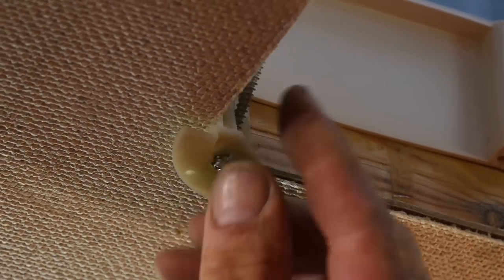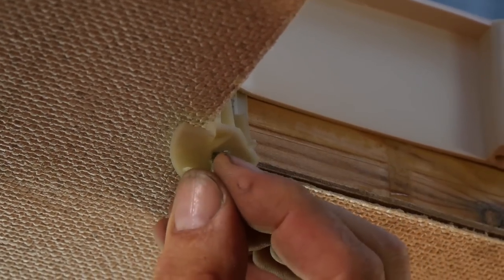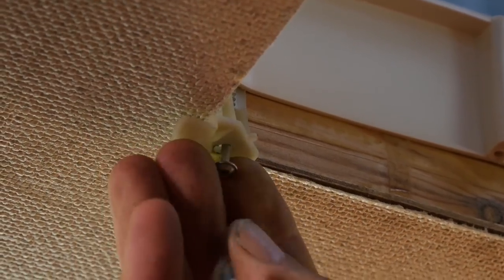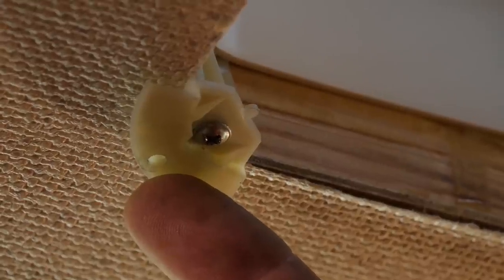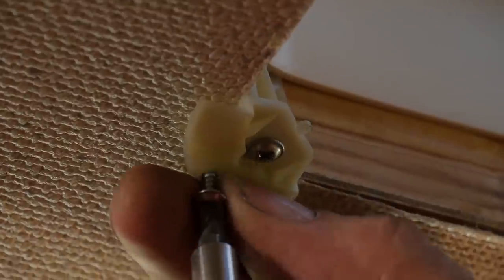That inserts behind the frame — then locate the screw into the hole and just screw it in gently. You may have noticed that there's a second hole in these fixings. This is so that we can put an additional screw into the roof structure, which will hold those fixings firmly in place so they can't slip off and let the roof light come loose. So we just pop a screw up and screw it in.